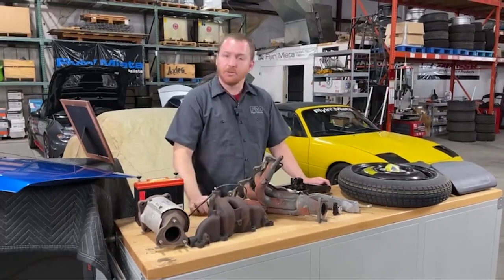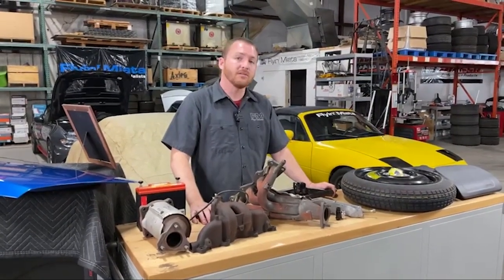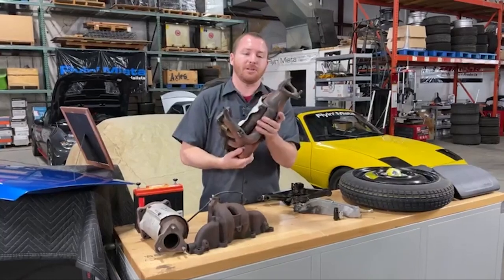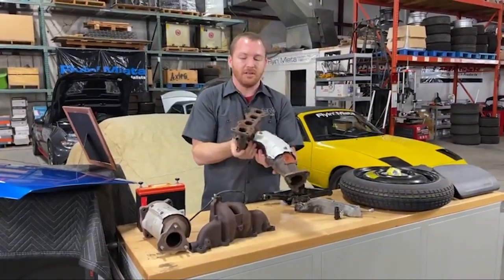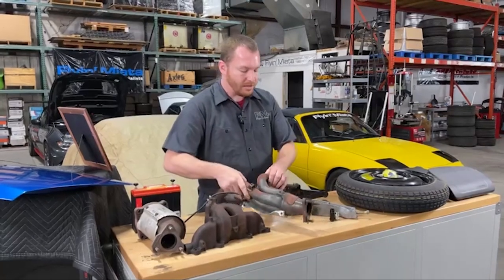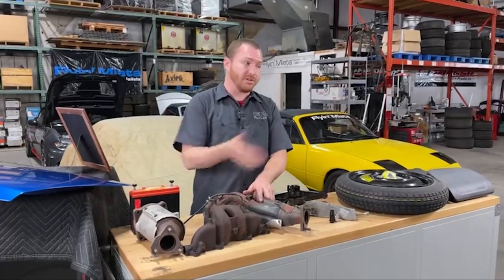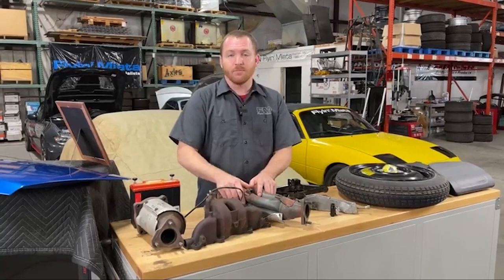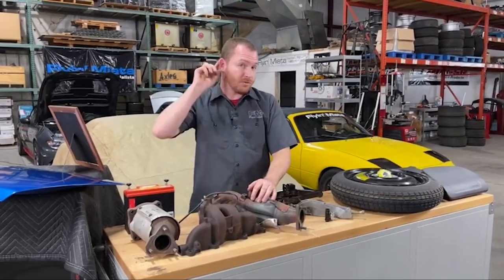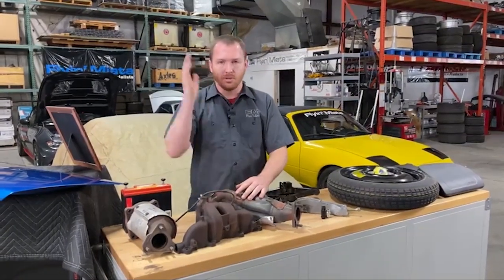Another super common thing that Miata owners like to do: aftermarket exhaust systems. These are generally made of thin wall stainless steel piping, which is much lighter than a factory piece — all mild steel, relatively thick wall, and bulky in general. Aftermarket exhaust systems are not only lightweight but are better designed for flow and are usually larger diameter, so you can have more volume exiting the car at any given time. Performance benefit for power as well as weight savings. If it's race car, just go with the lightest, lowest restriction one.